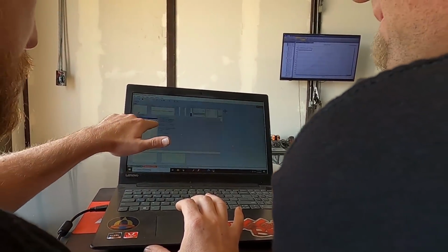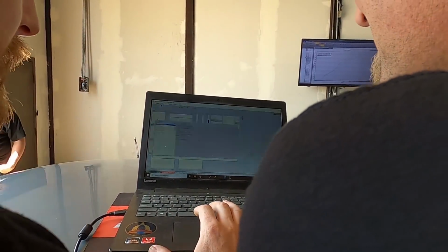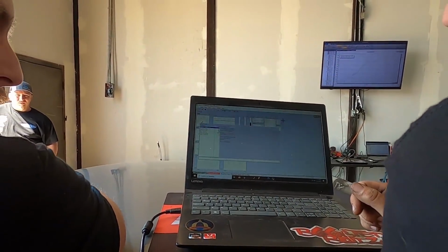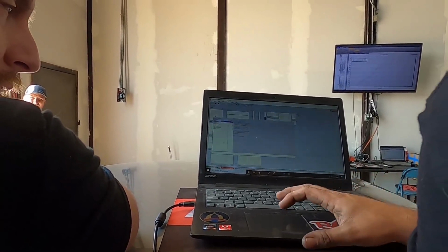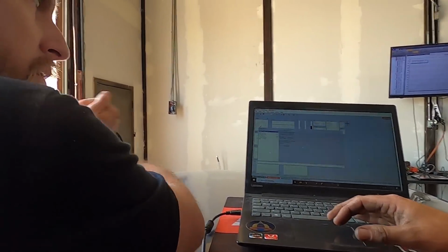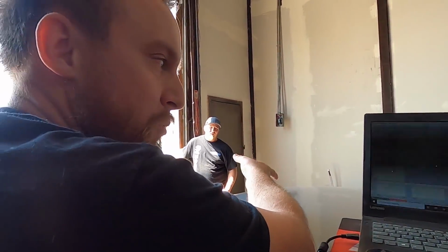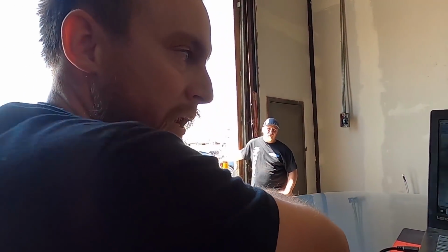So this right here, it's got a two in there. Yep. You're gonna want that two or somewhere between two and five. Okay, that's the millisecond scaling, your master pulse width. So if you want more resolution in the table, smaller number. If you want less resolution in the table, like if you had a smaller injector, I would use their recommended, so like 10 to 15.